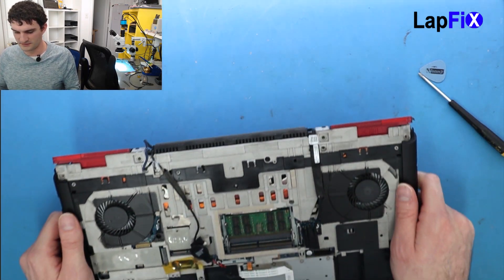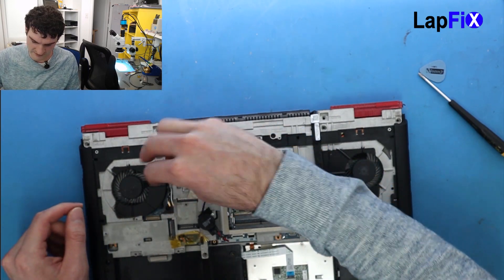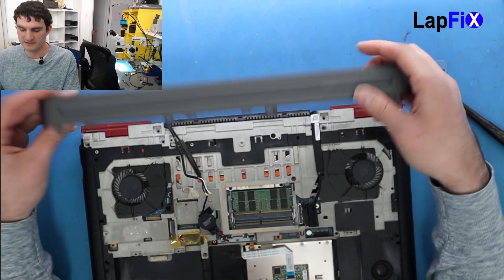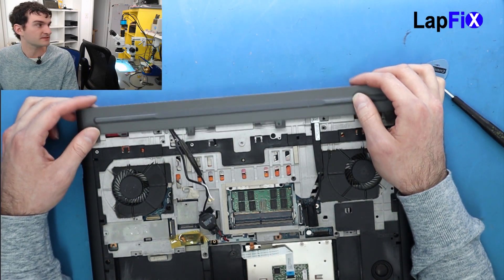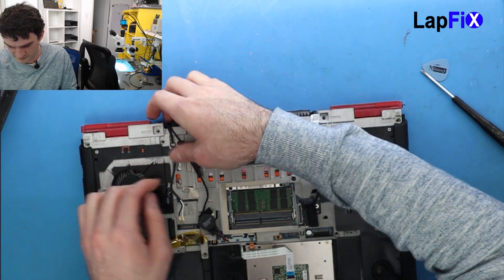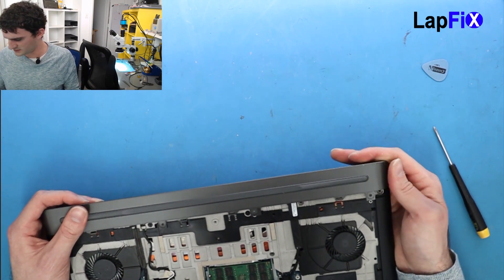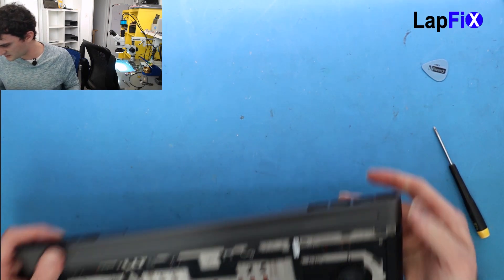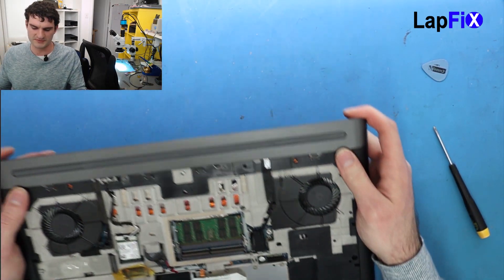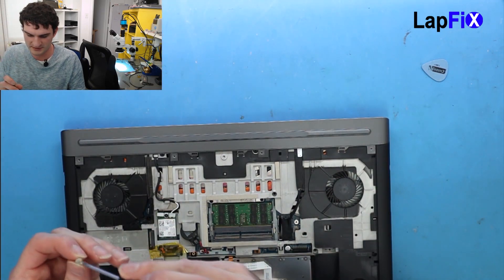Once this is down, plug in the connections up here first because they'll go flat. Make sure it's all even before putting the plastic piece back on, because once you do it'll totally cover them. Make sure the connections are good to go before plugging that piece in. It's all settled — you can see the clip, it's all flat, and the screw holes all line up.